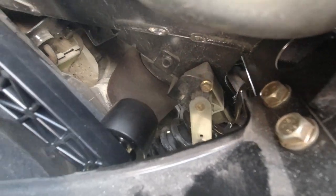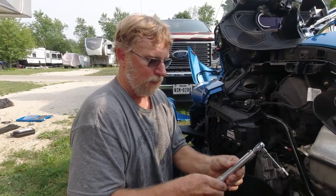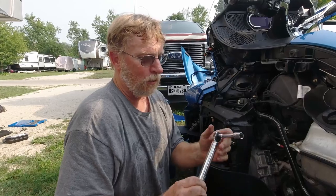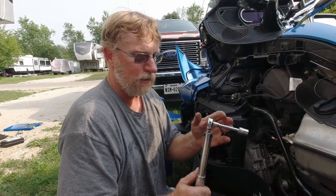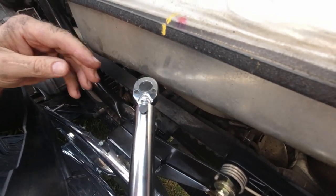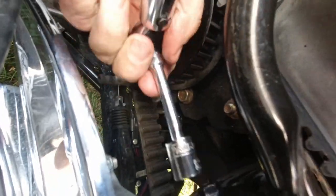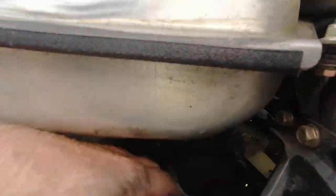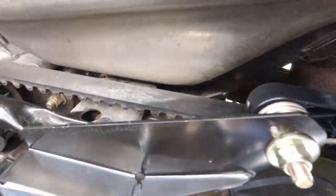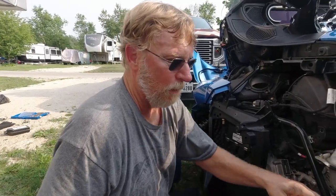I'm going to snug this down a little bit and make sure it's still in the same position. It's riding at 130 inch-pounds. I've got a little torque wrench that goes up to 200 — I set it a little higher because any time you add an extension you lose some percentage, so I went to 135. You tighten these up to 135 and your wrench will click when it's done. I'm going to take a little ride around the park before I put it back together to check that tension and alignment one more time.